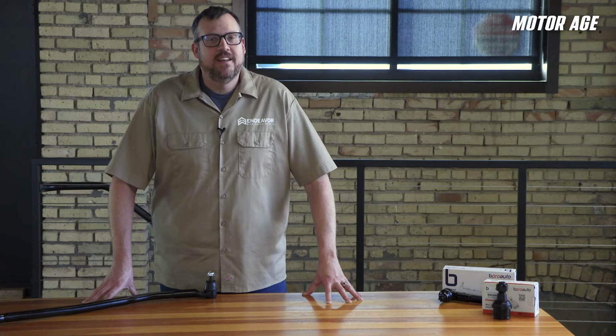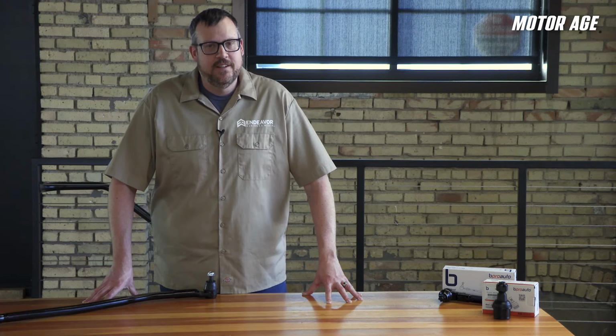So as you can see, there are plenty of considerations the technician needs to take when inspecting ball joints. Proper inspection goes well beyond simply throwing the vehicle in the air and just grabbing a tire looking for any perceivable movement. And remember, while this video is concentrating on joints themselves, don't overlook things like control arm bushings, and if you're chasing a noise, keep in mind those sway bar links and bar to frame bushings as well. Now let's move on and look at steering component inspection.